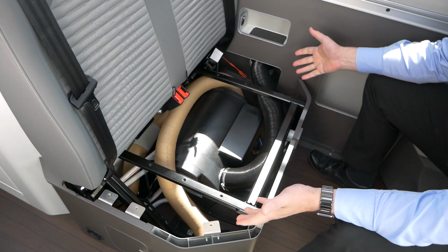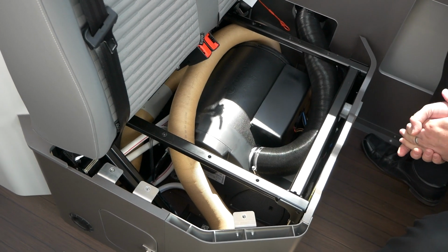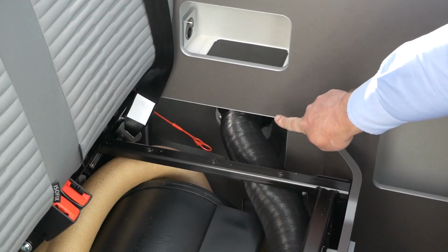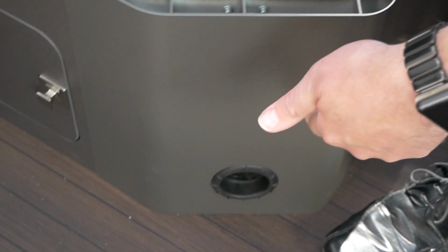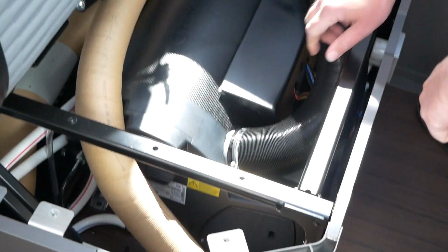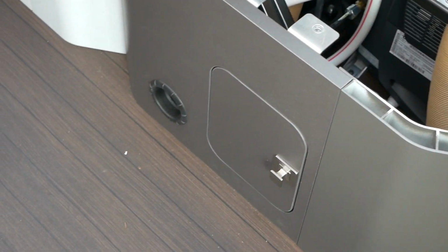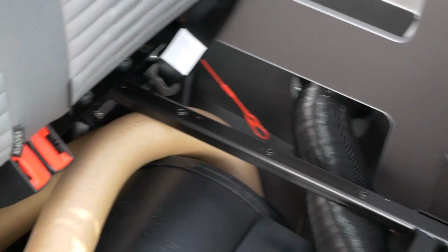And this is what your combi boiler actually looks like. It's a very simple, nice, compact, unique unit. You've got your big exhaust pipe, which matches up and goes straight out to the outside of the vehicle, and then all your beige pipes like this here, for example, this is your air output. You've got one down here, you've got one here, which is what this pipe here is for, and then just slightly at the back there you'll also see another one. So you've got one at the side there, and you've got the one which is running through into the bathroom as well. And then you've also got one right at the very bottom, which is running for your air intake right from the back.